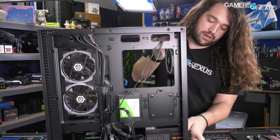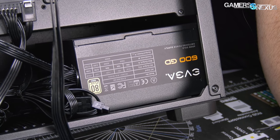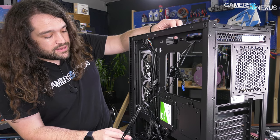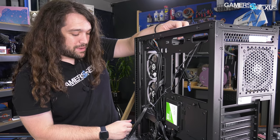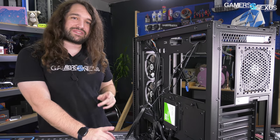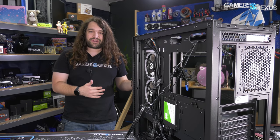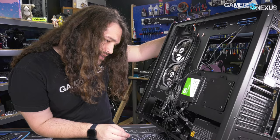For the rest, let's see what we have on this side. This is an EVGA power supply — 600 watt — with 18 amps on 3.3V and 5V, and 50 amps on 12V. So you do get the full 600 watt capability on 12V — that's a good thing. And the drives are initialized this time. Good job, CyberPower — you've figured out how to initialize hard drives. We've had that problem twice now with pre-builds where a drive was either not initialized or not connected. CyberPower told us they now run a script at the end of the build to make sure everything is there and working through some automation. That is an improvement — one they made in response to criticism last time.